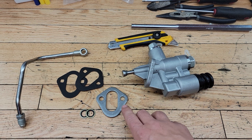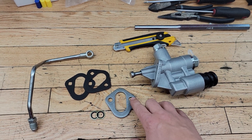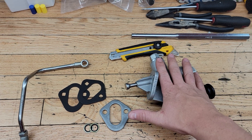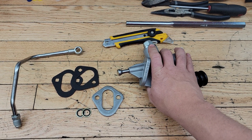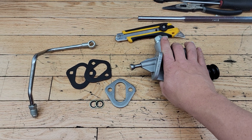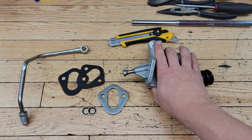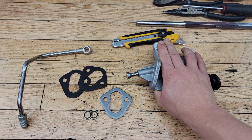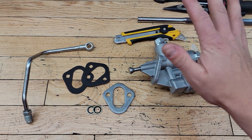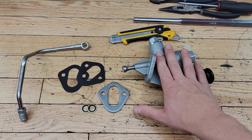The factory lift pumps on the first gens run about three to five PSI. These ones run about 15 PSI, and I'll show you with my fuel pressure gauge in the truck. It's recommended that you don't run any higher pressure than that because it starts to bloat the seals in the front of the VE pump, which could be a bad situation. This pump is designed perfectly to work in VE pump trucks.